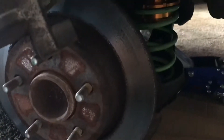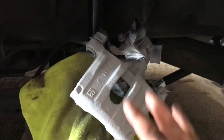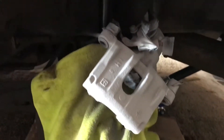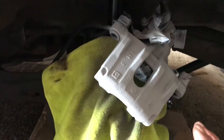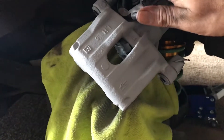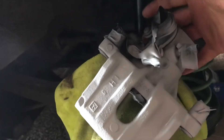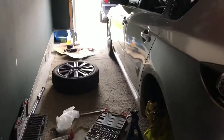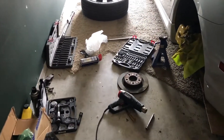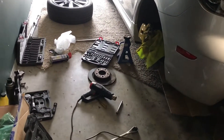I gave it a coat of primer. Before that I cleaned it — put some brake cleaner on it, used a brush, and cleaned it as much as I could. I did this without removing the caliper completely — I just taped up the holes for the fluid and everything else. I've got a mess of tools right now; I'm letting the caliper dry and I'm going to start working on the other side while this side dries.